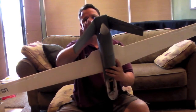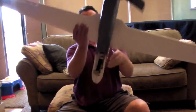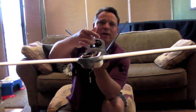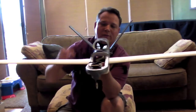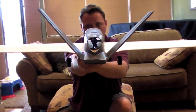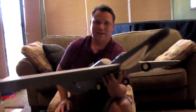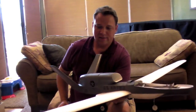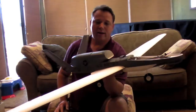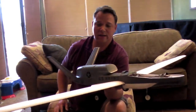These had to be sanded to fit properly into the fuselage. I did have to open up the EDF inlet — had to open it up a lot — same with the exhaust tube, had to enlarge that as well and smooth it out for smooth airflow. I do have the excess EDF fan in there from the Phase 3 F-16, and it puts it at about 356 watts. It does a good job at flying this airplane.